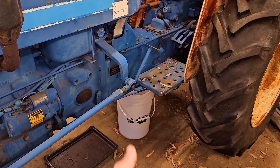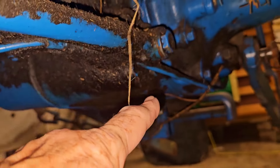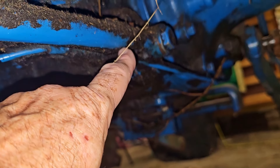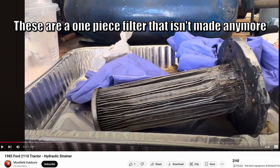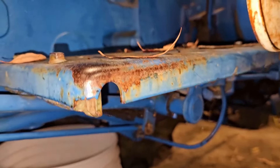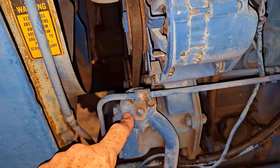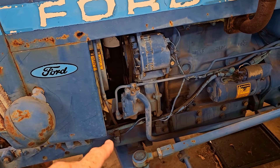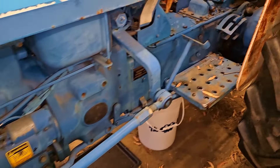As for the power steering filter — it's this little jobby here. That's the pipe that takes it up to the power steering pump. Inside this round container is a little stainless steel mesh — it's a probably fairly large micron mesh strainer filter, just to take any debris out. Then the hydraulic fluid comes up here to the power steering pump. Craig did suggest we may have some gunk in there as well that's causing issues, but we'll just see what condition the filter is in first.